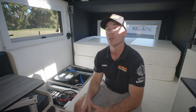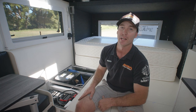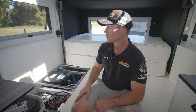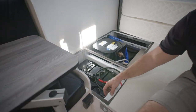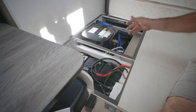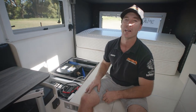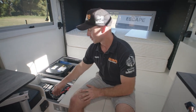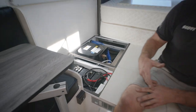The Infiniti range is fitted with the Truma 14 litre ultra rapid system, which is a 240 volt and gas system. When using 240 volt, it is plugged into the GPO under the bed — we're simply turning it on and an element is heating up the hot water. It's automatic and will reheat as the cold water enters. When we are finished with it, do make sure you turn it off, so that when you get home and you are charging your batteries you haven't left that on — either cooking the water left in it, or if you have drained it out, burning out the element.